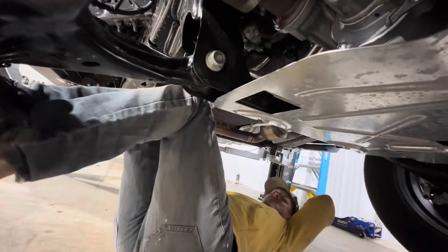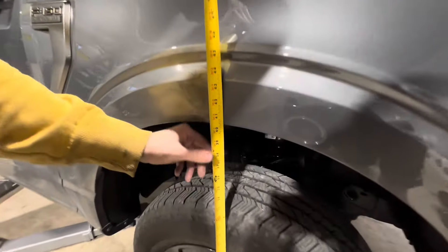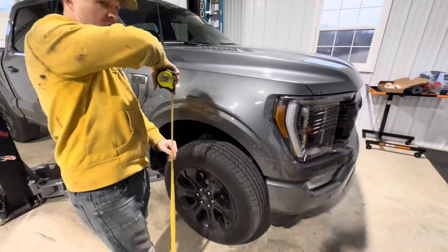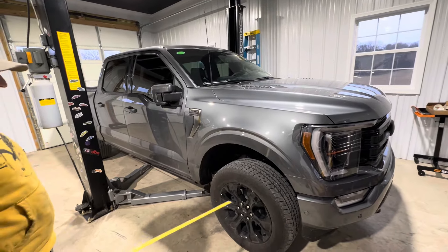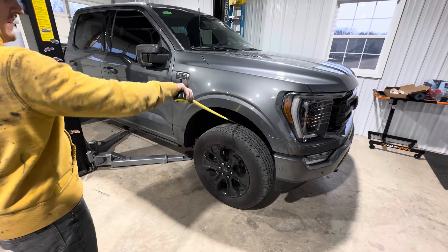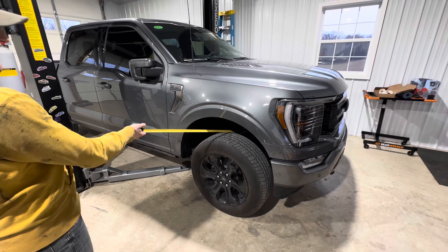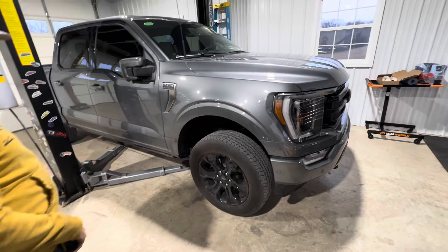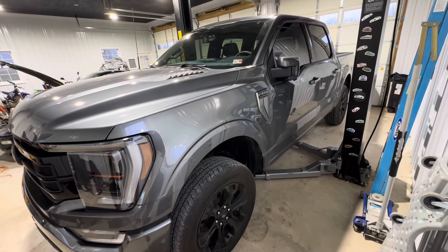Now for the determination: we started at 37 and three-quarter inches, and now we're sitting at about 40 and a half inches — level front and rear. There's your clearance on both sides and a little more clearance at the knuckle, so you can fit a 35x12.50. That's the biggest you can fit — you only have about three-eighths of an inch of clearance at the top knuckle with 35x12.50s. Next step is to get the KO2 35x12.50s mounted.